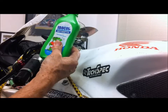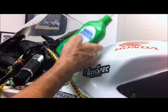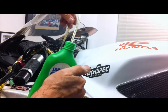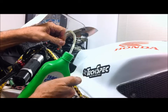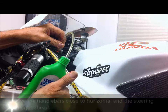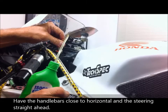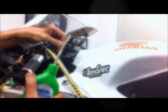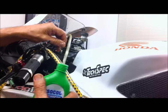This is not a bad idea: get yourself a little plastic bottle with fairly stiff sides and a hole in the top with a plastic tube in it. You can squeeze the sides of the bottle to push the air out. I've got a cable tie set at 170 millimetres on the tube. Just push that down the side in the middle there and just let the bottle suck the excess out. You take the level from the top of the outer tube — not the inner tube, the outer tube. So that's set at 170 millimetres.